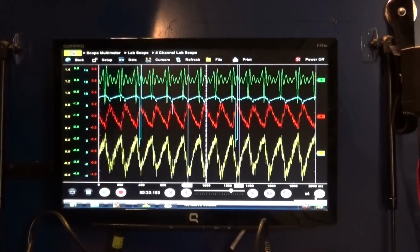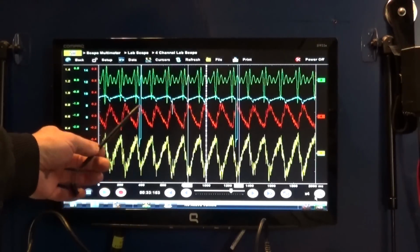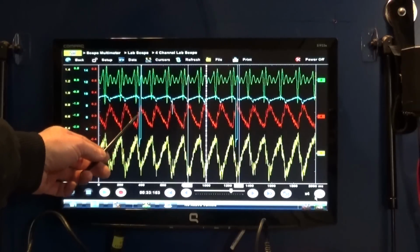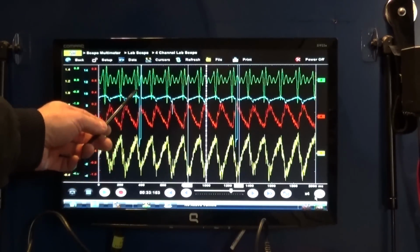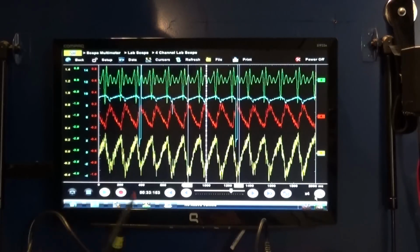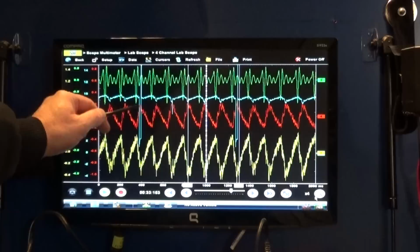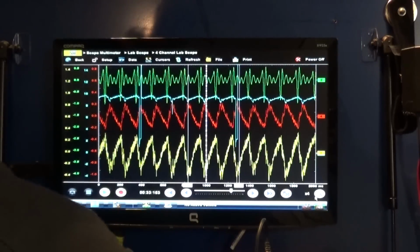Alright, so now as we can see, this is my number 2. Again, there is no problem on this engine, and the reason we were receiving that lower amperage is because of the hose that was hooked up to the cylinder. There was a higher volume in our cylinder number 2 because of the hose. The piston was pushing the air into the cylinder and the hose, and that's why we're seeing the lower compression here.